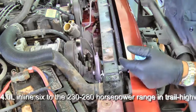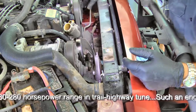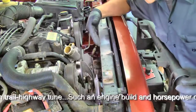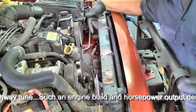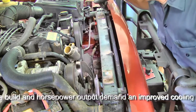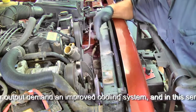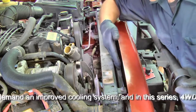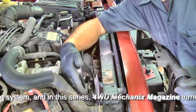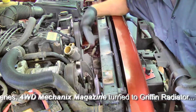At this point, the radiator can actually come out. Remember, we have to disconnect that lower transmission cooling line on the other side, and we can remove the radiator hose now or it can come out with the radiator. Since we have air conditioning, we have one more step before we remove the radiator. The radiator is loose, but we have the air conditioning condenser at the front. So we'll loosen the top support nuts for the condenser and free the condenser from the radiator without uncoupling the air conditioning hoses or lines. This way, we won't have to recharge the air conditioning system.